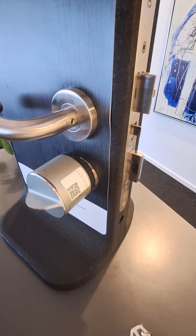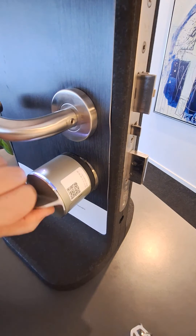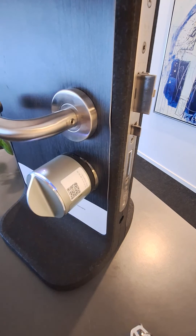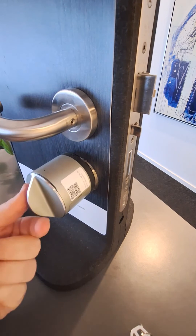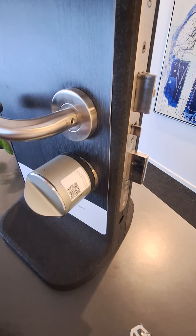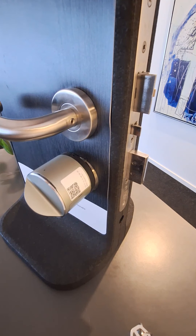The lock will return to the lock position. From there, turn it to the unlock position, but just towards unlocked and no further, and give it one click. Now turn it to the lock position again, only to where it's just locked and no further, and give it one click. This completes the calibration process.